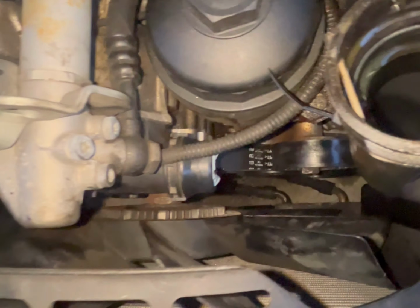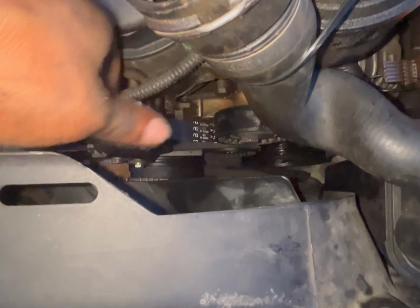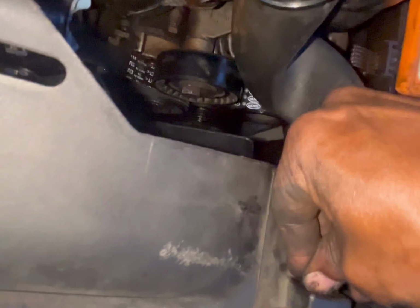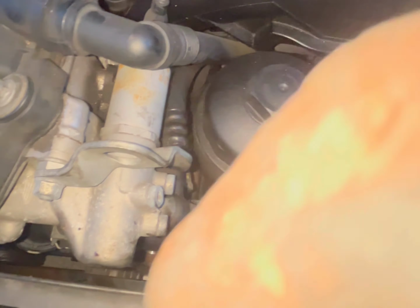Okay, so after you have your clutch fan back in place, remember, lefty is tighty in this case. You're going to put your hardware back in. So you have the tab that's on this side. Just going to push that back in there, just like so. And also your one over here, tighten it. And then you want to take your 32mm wrench, place it over the nut for your clutch fan. You're gonna turn it to the left to tighten.